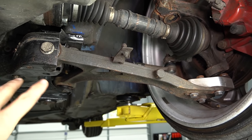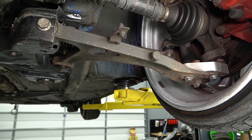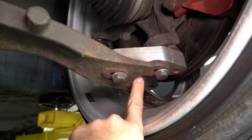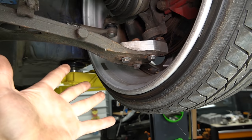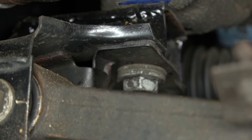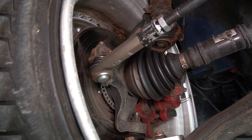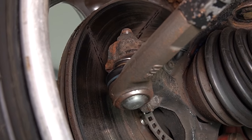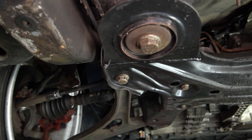We'll start here on the lower suspension. This is our lower control arm — actually an R32 control arm and spindle that allows a little bit more negative camber. Moving down the control arm, you can see that plate right there. What that does is take the ball joint, which would normally be right here, and pushes it out another two to three inches to move the bottom of the wheel out further, giving you even more negative camber. We also have a modified subframe so that we can actually raise the engine up at both mounting points. A lot of people will also flip the tie rod upside down — rather than coming from the top down, it goes from the bottom up. This is actually the normal setup for an R32, and there also looks like an extender piece to lengthen the tie rod a little bit.